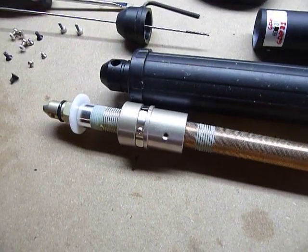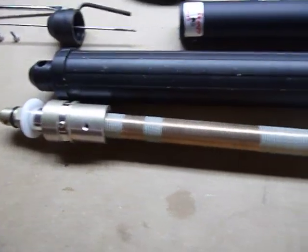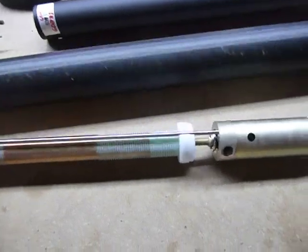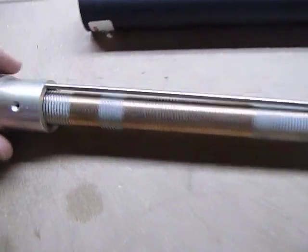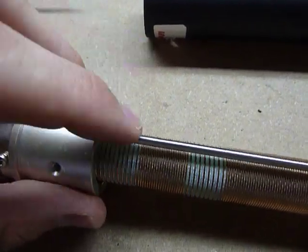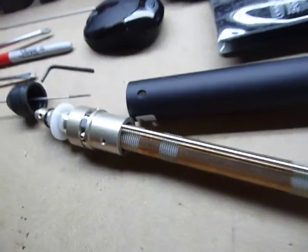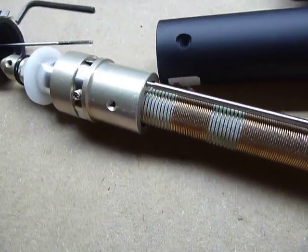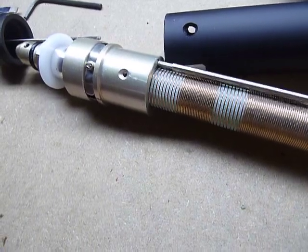As you can see, as you pull the antenna down, it goes right past the wiper on the motor. When you've got it apart, be careful — if you make it go up, there's a little shaft right here that connects the bottom to the top, and it will slip out. If you make it go up, see how it comes right out? So when you back it back down, make sure it goes inside that hole.